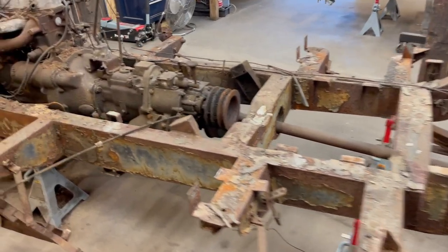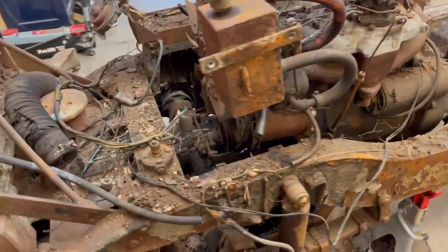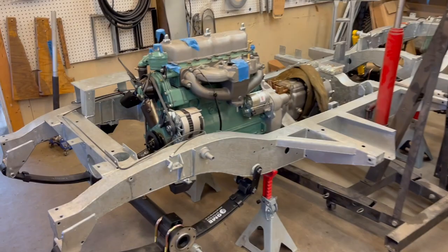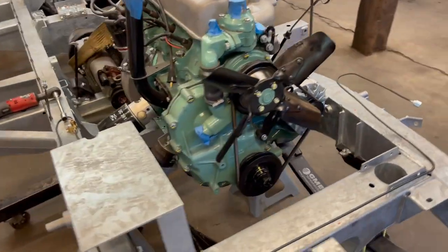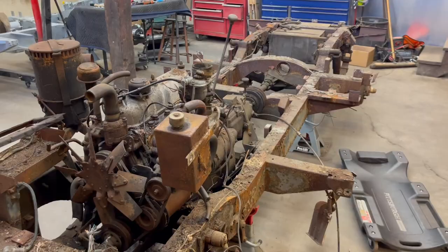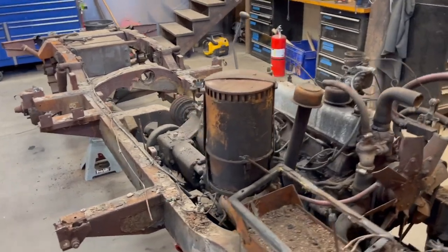It has single master cylinder drum brakes that have to be manually adjusted. The fuel system on the original vehicles is prone to vapor lock, and today's 10% ethanol gasoline is to blame for that. The positive ground electrical system is not really the best design. It has extremely stiff suspension that was really made to haul much heavier loads than most people use them for today. Parts are prone to rotting out, like the frame, and galvanic corrosion between the steel and the aluminum body panels.